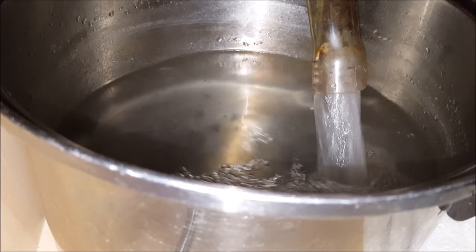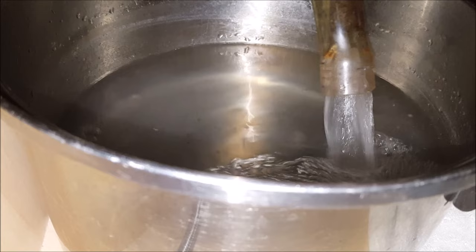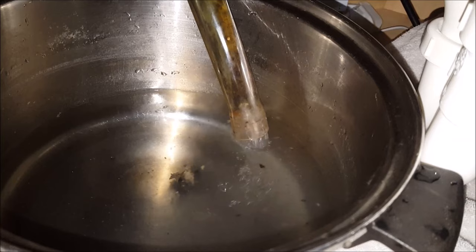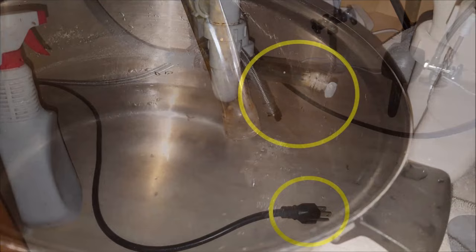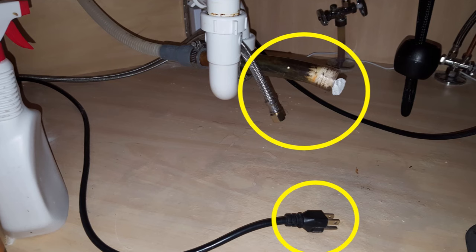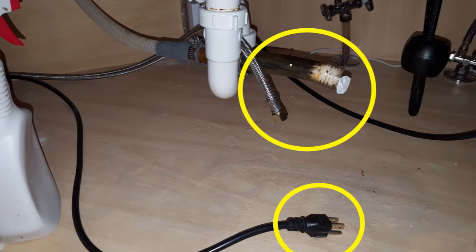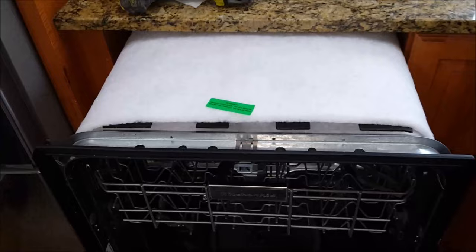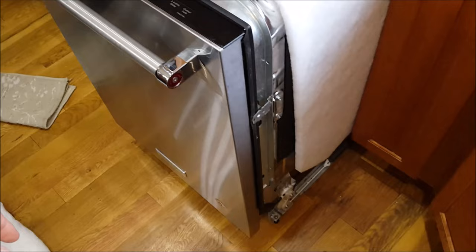If it does blow through, that means the hose is working properly. But if you are unable to blow water or air through the hose, that means there is some sort of blockage in the middle of the hose and it needs to be cleaned out. This can be somewhat difficult, and sometimes it's easier to just replace the drainage hose, but I've had luck clearing clogs with very small hand snakes or even metal hangers. In my case, the drainage hose is not the issue either, which means there must be something blocking the drainage pump internally. To inspect the drainage pump, the dishwasher will likely have to be removed, requiring you to disconnect the water, electricity, and drainage hose.